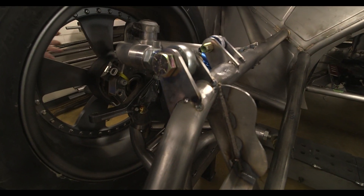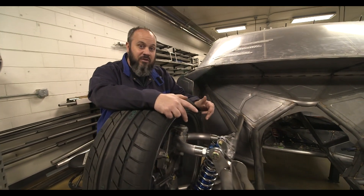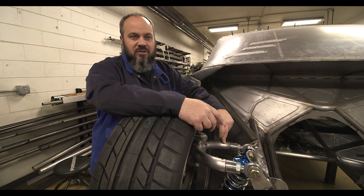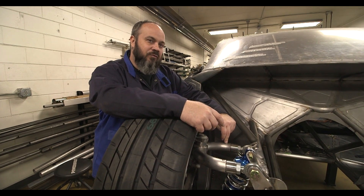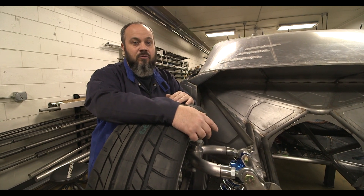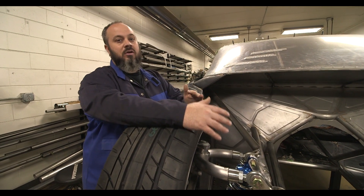There's a reason why people don't do this — they just call up the catalog and order the parts. You're not going to find these on the shelf. These are really heavy duty control arms. Normally you'll see like a one-inch or one-and-a-quarter control arm; this is one-and-five-eighths, 0.095 wall, and on top of that it's 4130 chrome moly, high carbon — really stout, really strong. That's what we need for land speed racing; we don't want any failures.